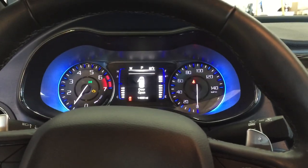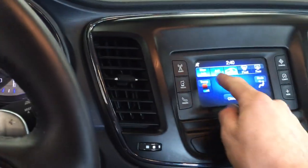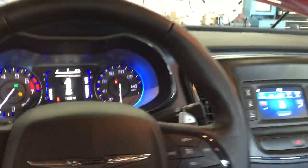Knowing it was probably another bad radiator fan, like I'd seen before, we go over here to the scan tool, hit climate on and max AC. That'll command the air conditioning on full, and the fan should spin. What I found was the fan wasn't spinning.